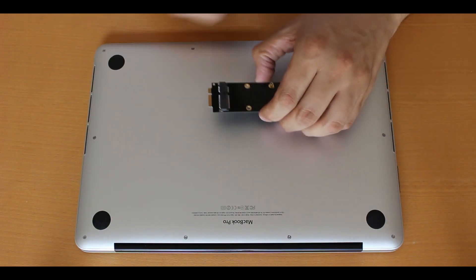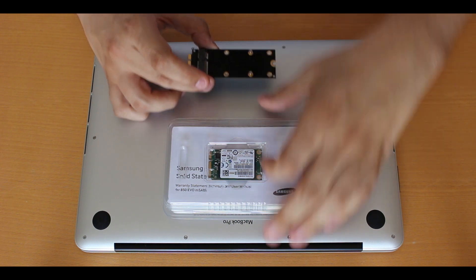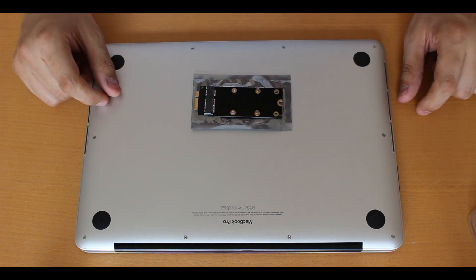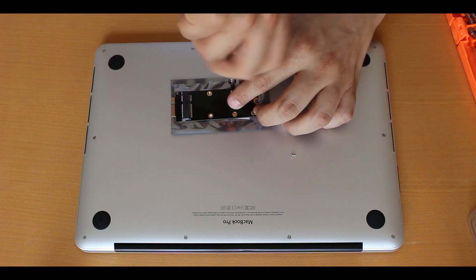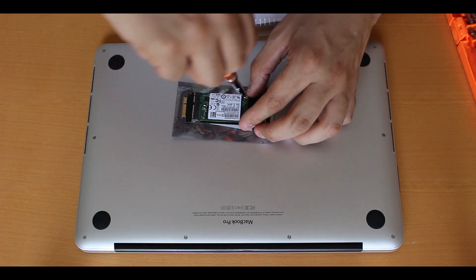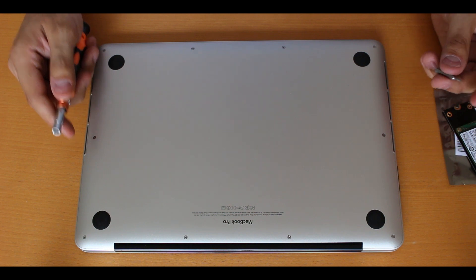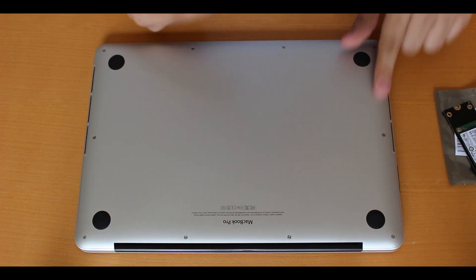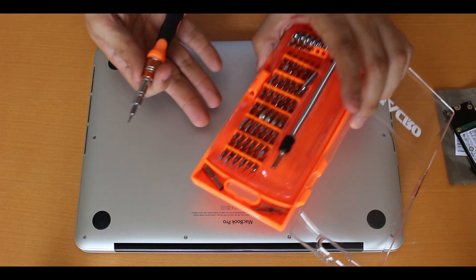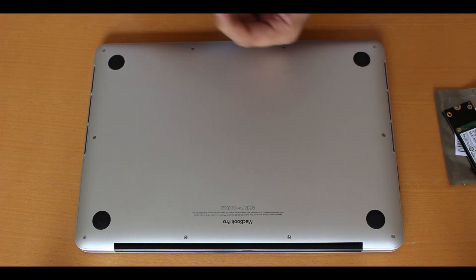On to the upgrade. I've got my 17-and-7-pin to mSATA connector board here and my mSATA SSD. I'm going to place the mSATA SSD into the board and open the MacBook to get it installed. Just before I continue — on MacBooks and many other Apple devices they use this Pentalobe screw bit, which I didn't have. I've had to buy this screwdriver set which has loads of little bits, and I'm using the 1.2mm bit to undo the screws.